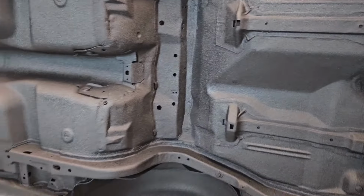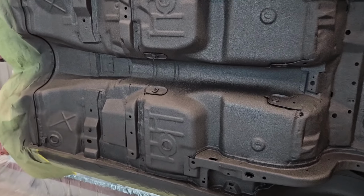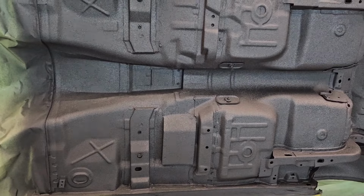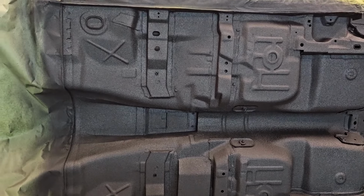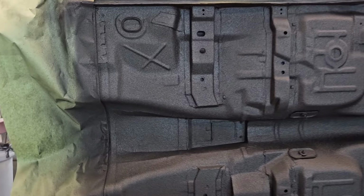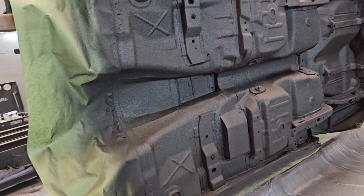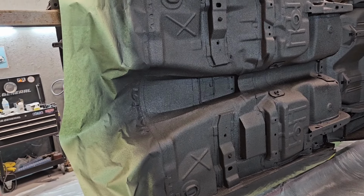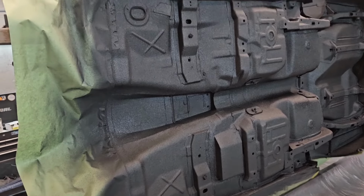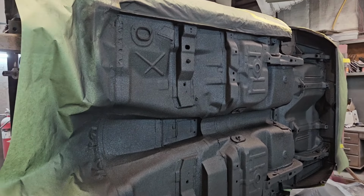So especially for a good driver quality car, and it's going to be a high-end driver, don't get me wrong, but you're planning on getting out and driving this car, and you can get years and years of abuse on this. It protects the floor pans. Sealing everything up with a seam sealer helps keep any water out of there, so it'll help with future rust damage. And with the Raptor on there and the epoxy that we've got, that floor is absolutely sealed up, and you will not have to worry about it for years and years to come.